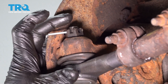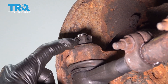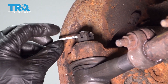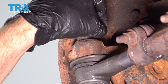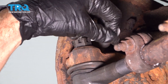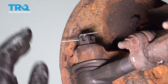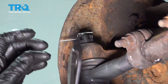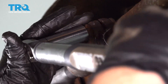At this point, locate the hole in the ball joint stud for the cotter pin to come through and install our cotter pin. If the notch in the castle nut does not line up with the hole in the stud, never loosen the nut to get it to line up — tighten the nut just enough where the next notch comes through, then install your cotter pin. Bend this up and over, and cut off the excess. Let's go ahead and torque the adjuster clamps down to 42 foot-pounds.